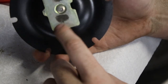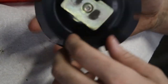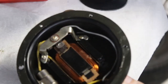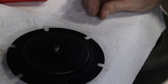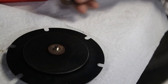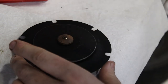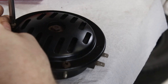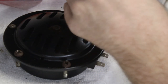Reassembling this portion, it has to be orientated correctly — this little tab pushes on the little spring contact, but this only bolts down in certain positions. I've pointed the tab directly at one of the screw holes, which matches up with where the little tab is. As for the screws, I haven't decided whether to zinc plate them — I have a zinc plating kit but it's a fair bit of work. Looking at pictures online, it looks like these horns at the factory were assembled and then painted black. That's probably half the reason they paint stuff like this after it's assembled.